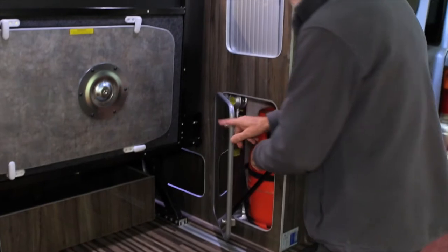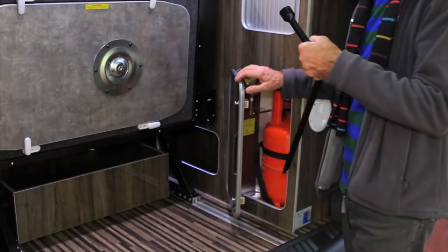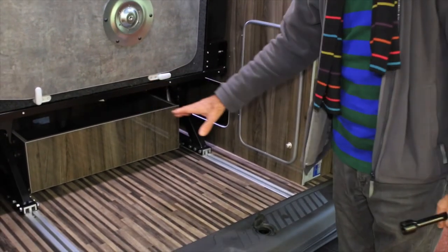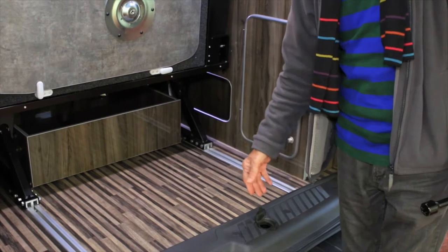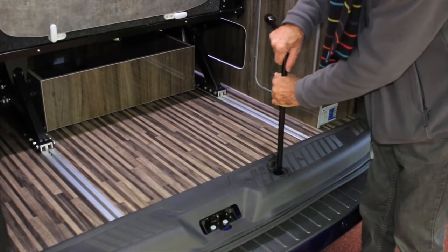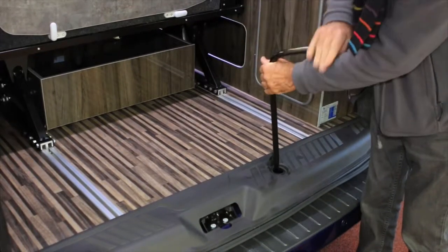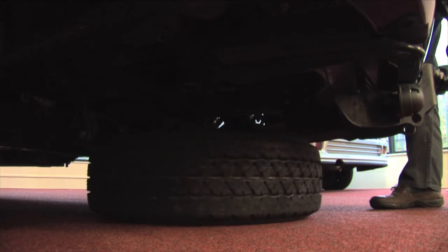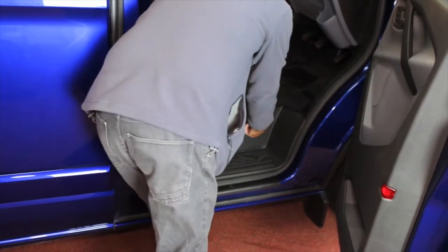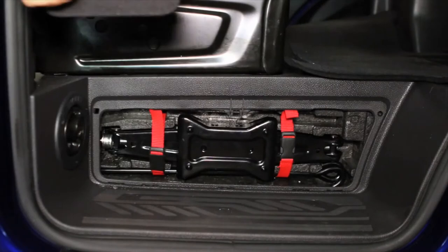Punctures are pretty rare in today's motoring conditions, but if you are unfortunate enough to get one, you'll need to know how to change the wheel. First of all, make sure you know where your wheel brace is stowed. If the vehicle is full of gear at the back, don't despair — you don't need to unload it all. Simply open the panel, insert the sharp end of the brace and you can lower the spare wheel on its own little winch. The jack is conveniently located behind a panel under the driver's seat.